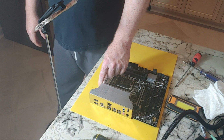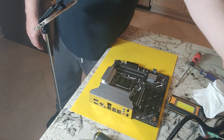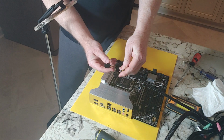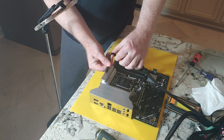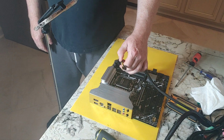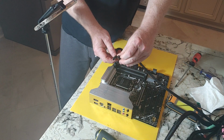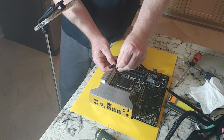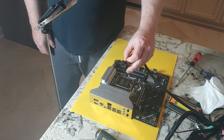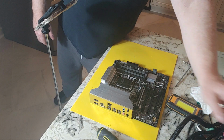All right, CPU power connectors, folks. Just so happens we've got one of these lying next to us. So what you want is 3 of these guys, okay? It'll say CPU on it. Your power supply has to be an upgraded one. One of those cheap ones is only going to come with maybe at most 2 of these guys, okay? The one that this is actually attached to has a spot for a 3rd and a 4th set, but I don't have it plugged in.